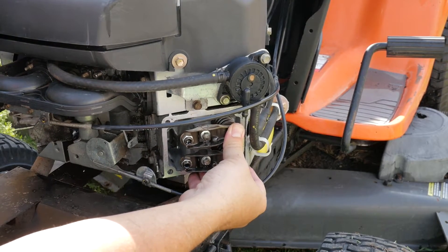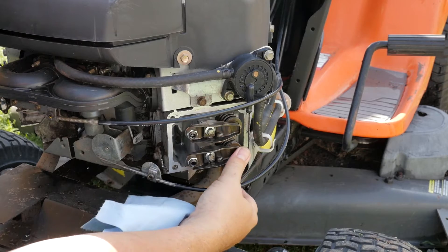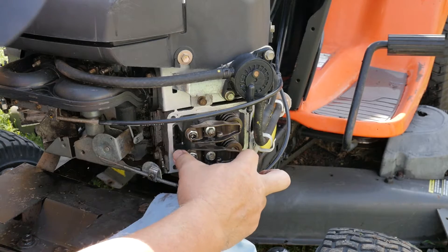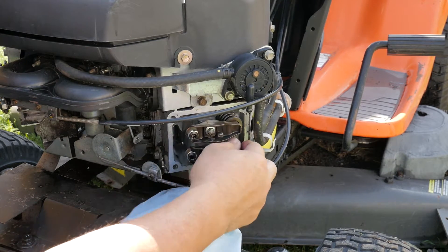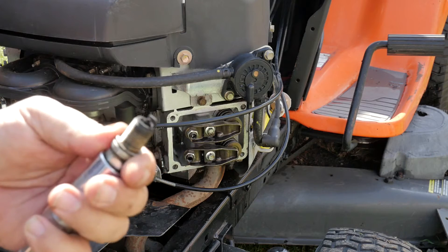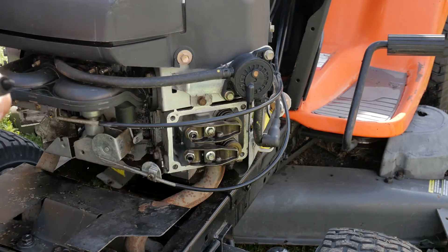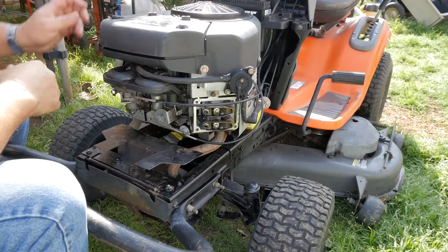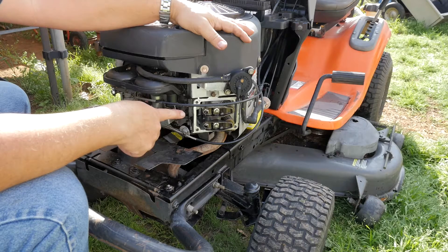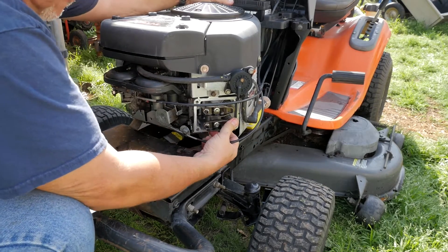This valve is moving, but I wonder if it's at top dead center. Yeah, this other valve is just plain stuck. Looking at the plug on the other side, you can see all the carbon deposits on it - so it hasn't been burning well, probably burning very rich. I'm going to have to take the cover off and possibly take the head off on this side just to see why it's binding, because it is just frozen solid.